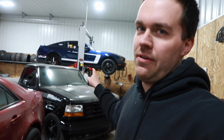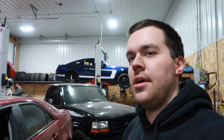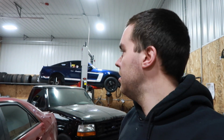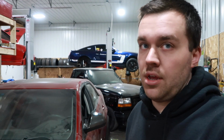Oh, right. So in true Streetcar Shenanigans fashion, we took the reins on David again, unfortunately. Sorry, David. But he told us that he wanted us to take the whole rear end apart, put a carbon fiber rebuild kit in the posi, and put just some Moser 31 spline axles in it. But I was like, hey man, you're getting to the point where you're at the limit of this rear end setup. We see them start to break around here, especially with the heavier S197 chassis and the stick shift. You should probably consider upgrading. And it's a track only car, it does not get driven on the street. So, you know, a spool makes sense and they're cheap. So 35 spline axles that I had in stock, and the spool is what we decided to go with instead. And C-clip eliminators are way safer, so you should have them anyway. But we will give you guys an update. We'll show you what we're putting in it here shortly.